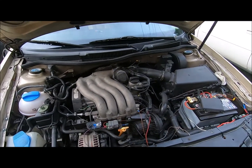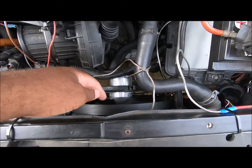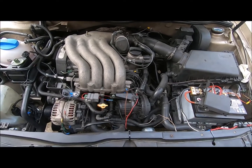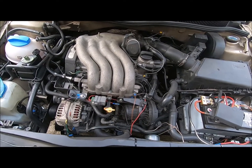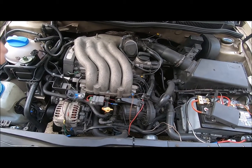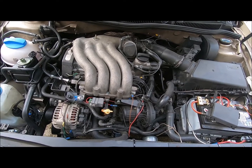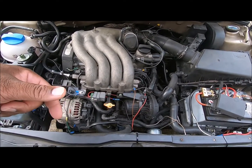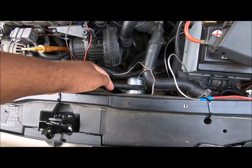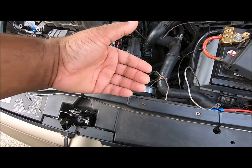This is a new cooling fan. Some weeks ago I was sitting at a red light and the air conditioning started getting warm. I pulled off at the light and got on the expressway — the air conditioning got cool again, so I knew there was a problem with the airflow. When I got to my next stop I got out of the car and this fan was not turning.